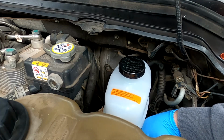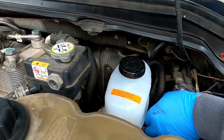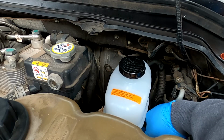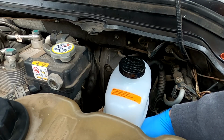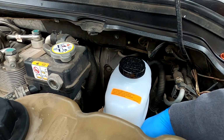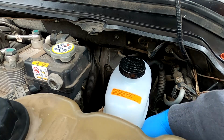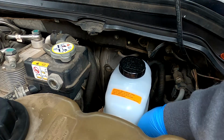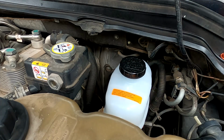Once you got them both started, I wouldn't say snug them up right now, but get them, you know, finger tight. You want them deep enough in there to where when you tighten them, you're putting pretty much final torque on them with a couple wrenches, or a couple swipes of a wrench. You don't want to be tightening these things forever when you can't move the master cylinder around. Plus, it gets this rag out of your way, and there's less chance of introducing air into the system, which you already have to bleed because you did open them.